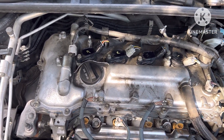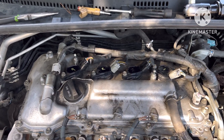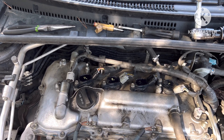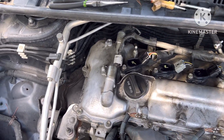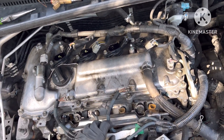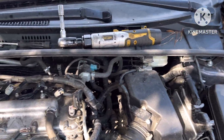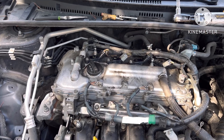When you replace the fuel injectors and first start your car, some fuel may come out of the injectors because they're not sitting right in their place. When that happens, you can just wiggle it a little bit until that gasket or washer grabs it completely and no fuel comes out. Now we're going to plug the wires back in. Hopefully you're not leaking any fuel — if you do, I'm going to wiggle the injectors. It is all good.